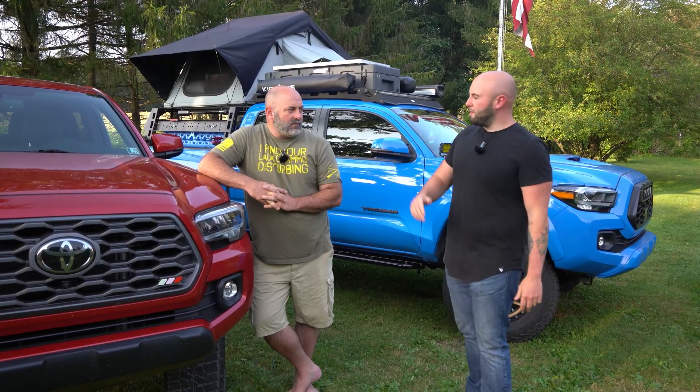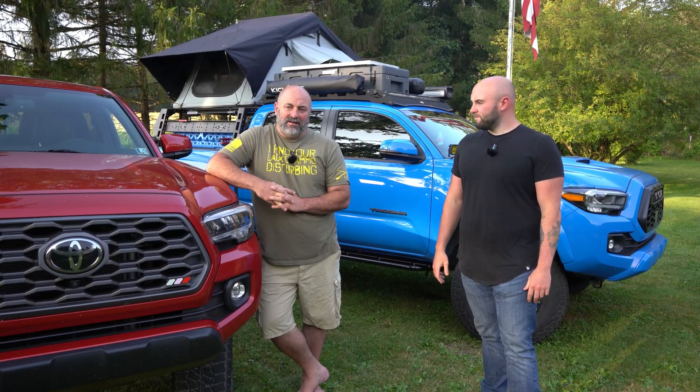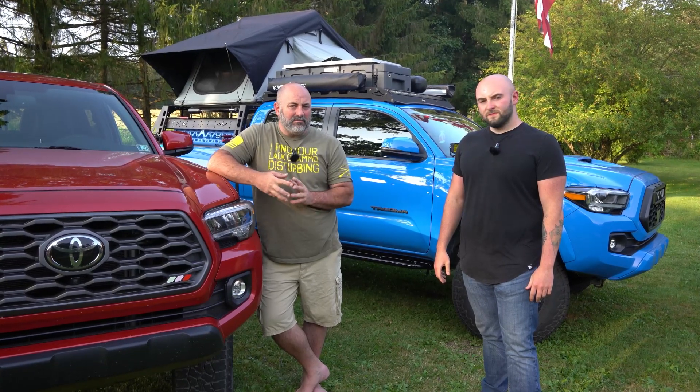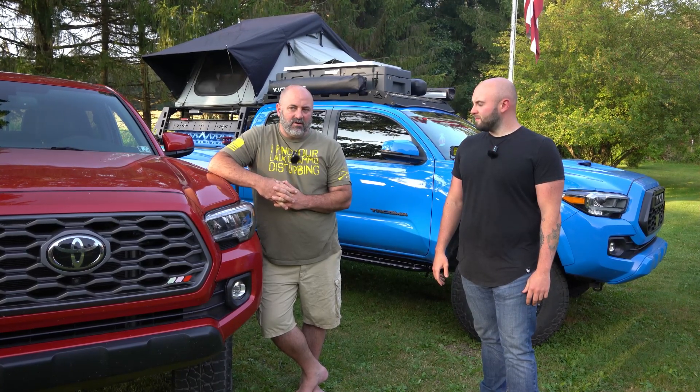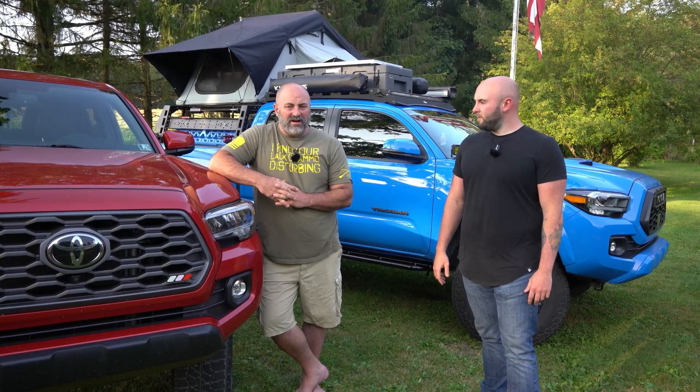Let us know what you thought about the install that you basically did on your own. It wasn't too bad. I did pull the drive shaft out because it's way easier to get everything with it out. If you don't have it out, you're going to be fighting to get the top shield bolts and everything. You might also want to get a vacuum pump to bleed the clutch, especially if you're doing it by yourself — you're going to need that. But all in all, probably about an hour and a half, hour and forty minutes. That includes grinding out the valley and everything. So yeah, it wasn't too bad.